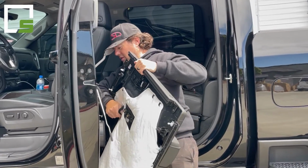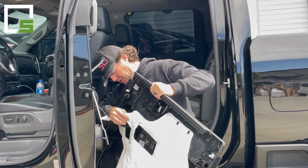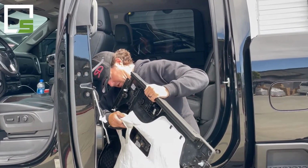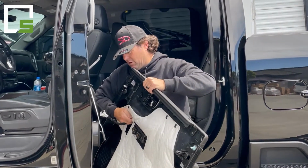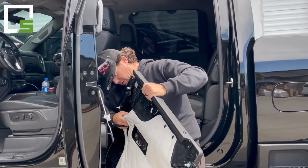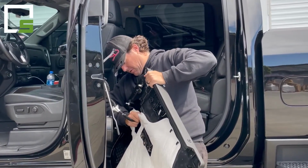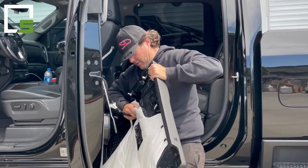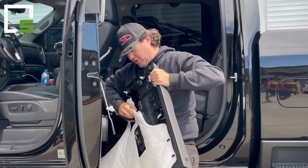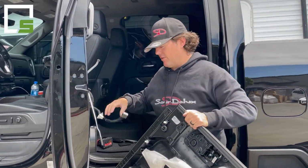And you have the wiring here. You want to release the keeper that's on the panel, just like so. And this one's a little difficult. The release is in the front, and you got to push down on the release and it'll come right out. It has a little safety on it, so I pull down on the white safety and you can release the plug. It'll come right out, okay?